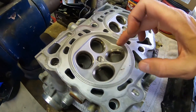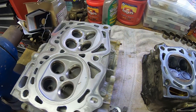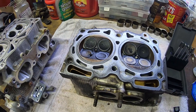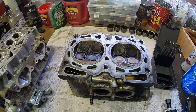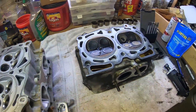The valve seat is this part right here — this is where the valve rests. I wouldn't want to nick that, that would be bad. So I'm going to leave the valves in for this first part. I got my marker here and I'm going to trace basically the size difference between the EJ20 head and the EJ25 head.